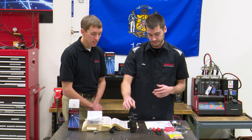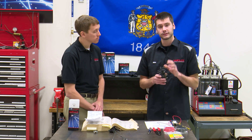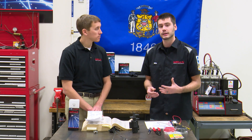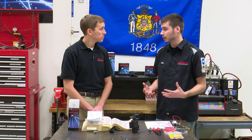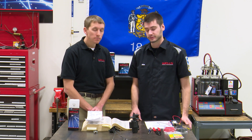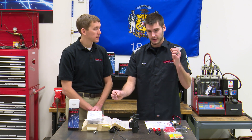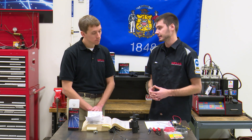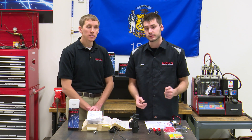You want to buy specific fuel injection hose clamps. You do not want fuel leaking. Those clamps give you a more secure connection and don't tear into the hose. You're going to run your hoses off this thing back to a universal fuel filter going to each pump. Each pump has to have its own fuel filter installed in line, otherwise you could void the warranty — and it's common sense to keep dirt and debris out of the new selector valve. You can just buy a universal fuel filter and install it in line between the pump and the selector valve. Make sure you have no leaks.